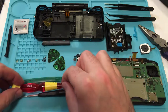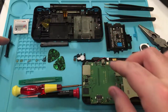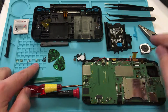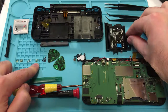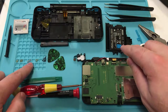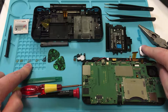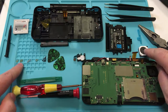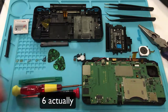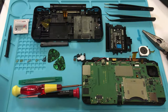This is labeled 2.0 — I'm not sure if that's actually accurate — but this is kind of the special Nintendo screwdriver. There are going to be four black screws in the back of the case that come out first. Before we even take apart the case, we're going to take out the game and the stylus. Then we're going to take out the two screws that hold the battery in place and the battery holder, after getting a couple of ribbons out of the way. Then we're going to take out the two screws that hold in the joystick directional pad.